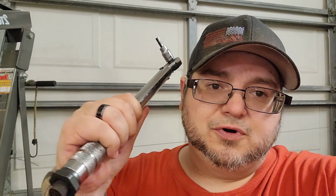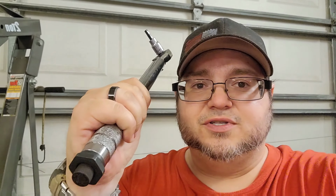All right, now that you got oil coming out of everywhere, you want to make sure to go ahead and lock down all your rocker arms and put 22 pounds of torque on them using your torque wrench in 2 steps. And then you're pretty much ready to go. You can seal it back up and you'll have an engine that's ready to go back into anything, and you don't have to worry about oil not getting where it's supposed to be as soon as possible.